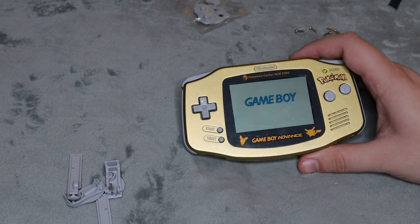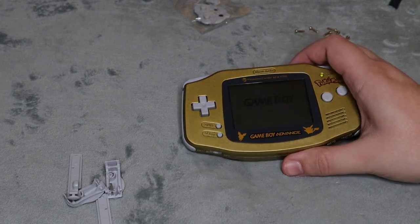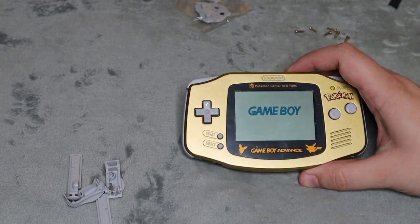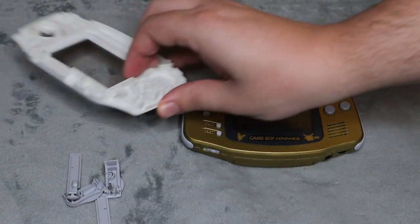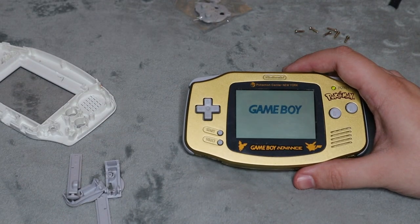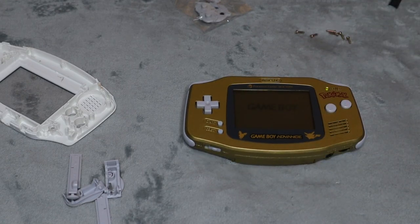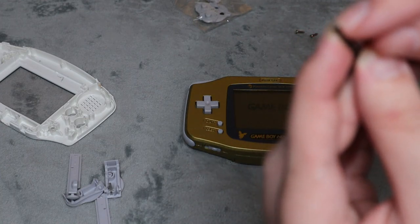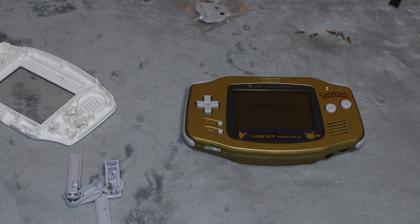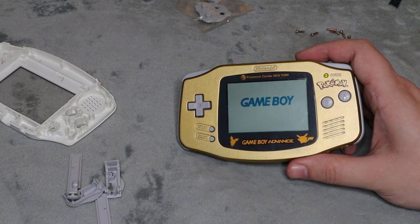It's actually really, really easy to do. All you have to do is take out the screws. One thing that I didn't show on camera is I actually used some of the screws that came with the replacement, because the shell is made a little bit different. Whenever I tried to put in the OEM screws that came with the original shell, I couldn't get them in for some reason — some of the holes are a little bit smaller. So I did end up using the replacement screws. Because the OEM screws started to strip since they weren't able to go in properly. So definitely use the screws that come with it. But it's actually super easy to do and it doesn't take too long. Hope you guys enjoyed this video — I'll see you guys in the next one. Please take care. Peace.